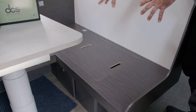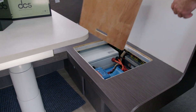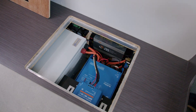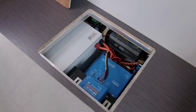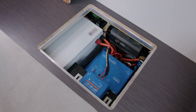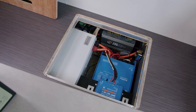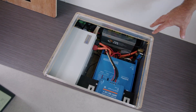The factory battery compartment electronics are hidden under this bench seat in here, so we're going to lift this compartment up and I'll show you the upgrades we've done. You've got two of our DCS 180 amp hour lithium auxiliary batteries inside this IP66 metal enclosure. You've got the Victron Multiplus 3000 watt inverter charger — that one gives you automatic changeover and battery charging as soon as you're plugged into mains. There's not much room in here but it does get very good airflow and we've left exhaust space for it as well, so it's going to have a pretty good life.